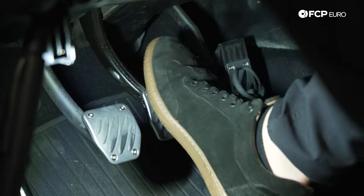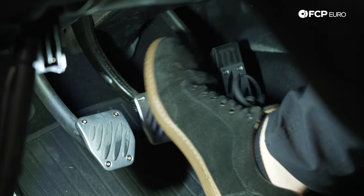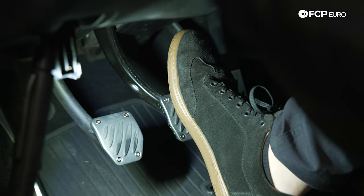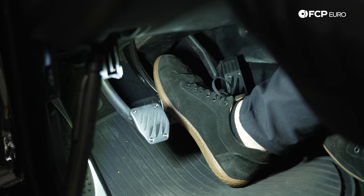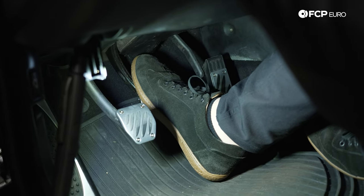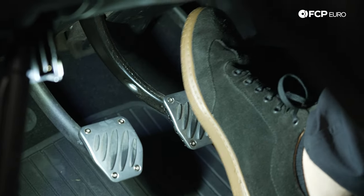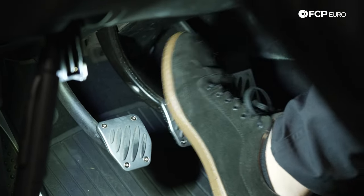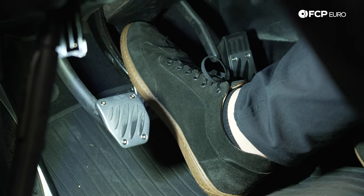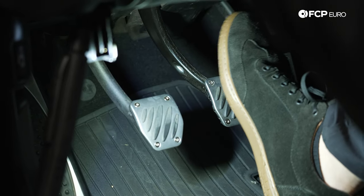As a proof of concept here, if I pump the brake pedal a bunch of times, it's firm right to about that point. If I just do one solid firm push as if you were stopping on the road, the pedal just keeps going. That is a very long pedal travel, and it has very little resistance. It feels normal here and then it just keeps going. That is not what I would expect it to feel like, and I've driven E39s before.